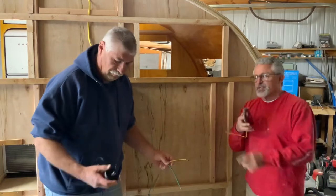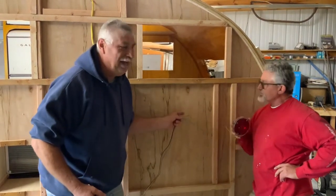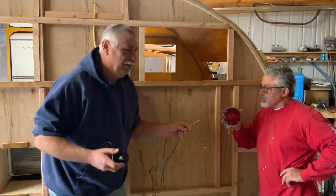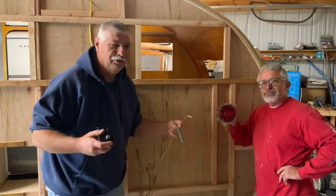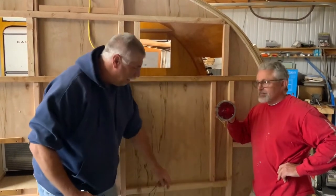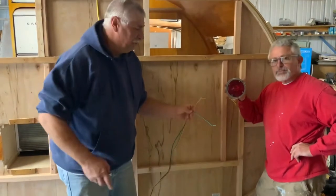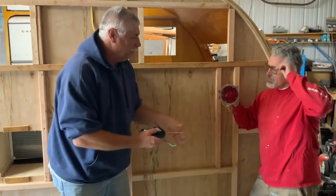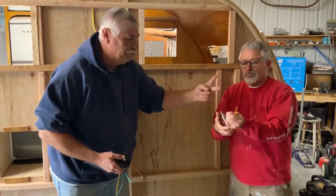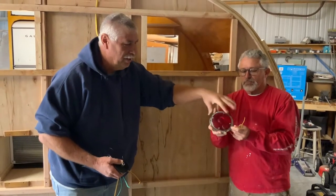I'm holding the tail light, but Jim's going to tell you about our side parkers. All lights in a camper, a wood camper, are grounded through the metal skin. That's different from a car trailer or utility trailer where you get the ground through the metal frame — you need to run a ground to the metal skin once it's on. Tail lights have two different elements: one bulb, but two elements. One's brighter, which is your brake and turn, and then your running lights — it's a dimmer bulb.